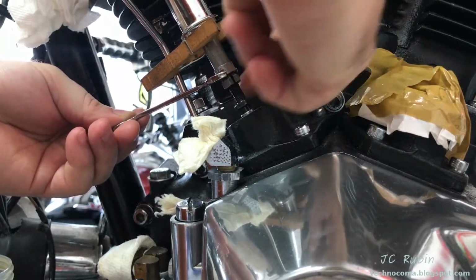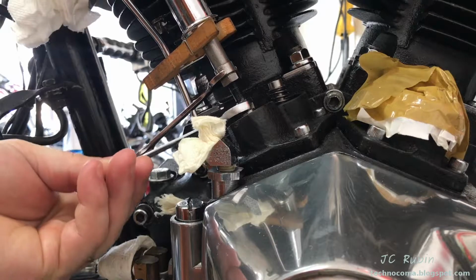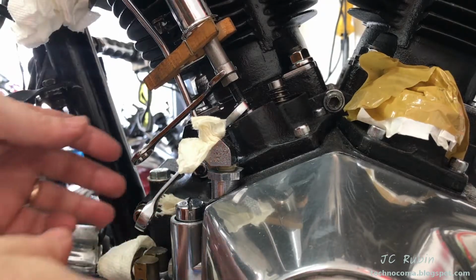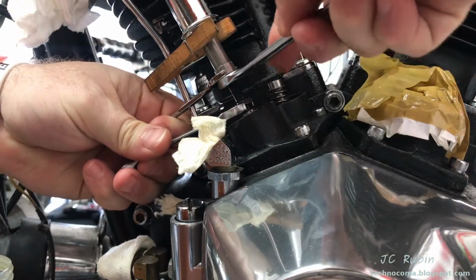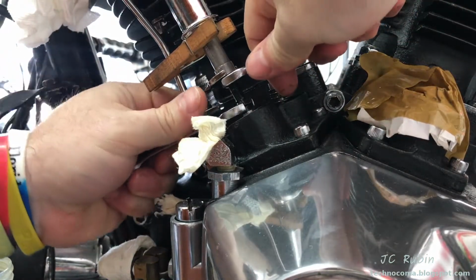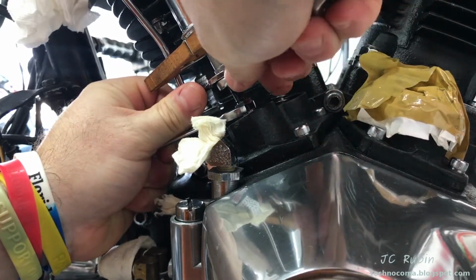So I'm going to turn the lock nut all the way up to the top. I've got my first wrench there. The second wrench will sit parallel to it, top and bottom. Third wrench will be placed in the middle, and that'll be counter-rotated against those two to tighten it in position. Going to snug it down real good.